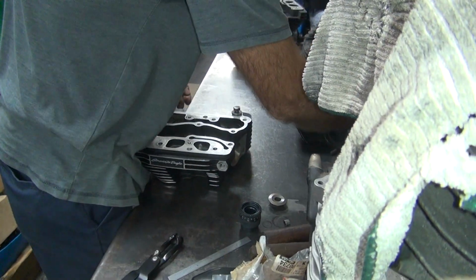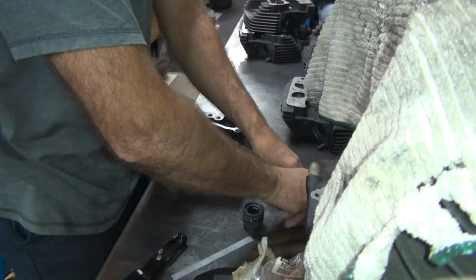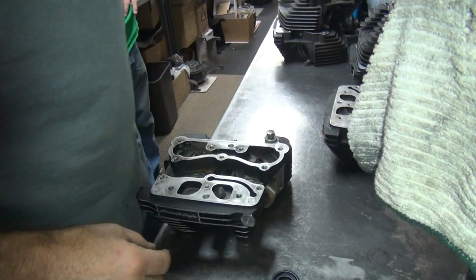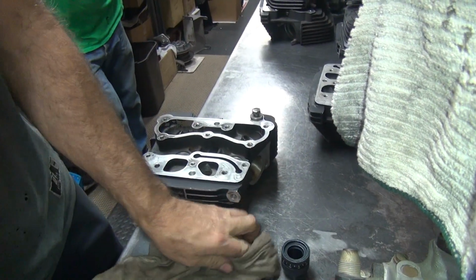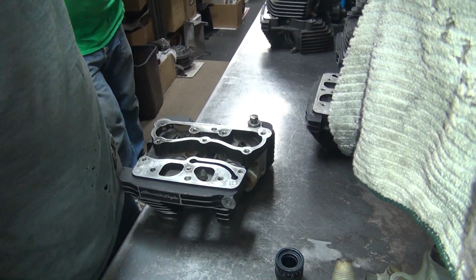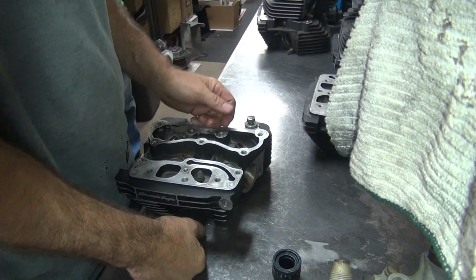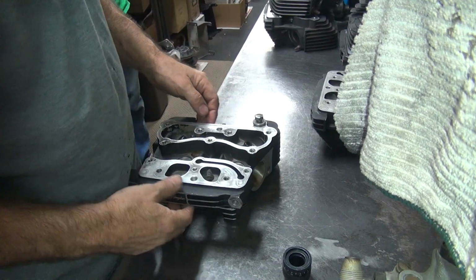I have to go and measure every one of these springs and make sure they coil bind at 050. So that's if you want to pack them in that far. You don't have to pack them in that far. Probably for safety, we'll pull 15 of that out of there. So we'll make it 65 installed height.